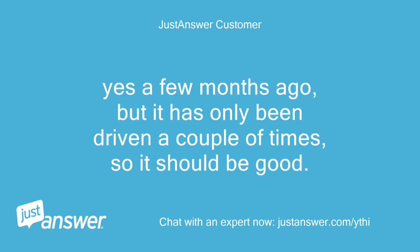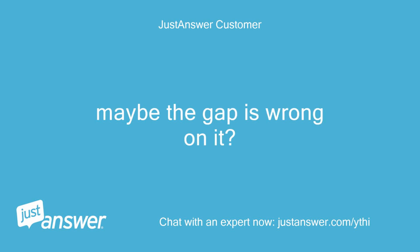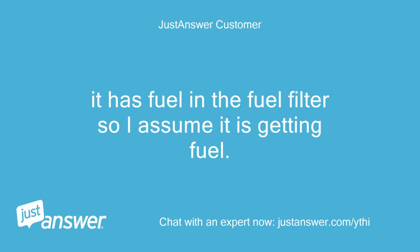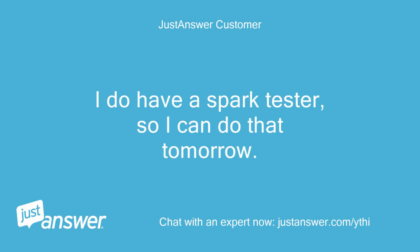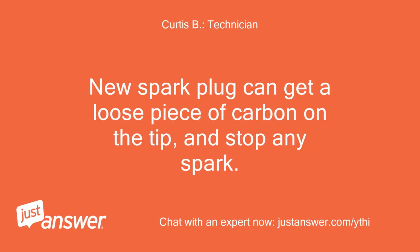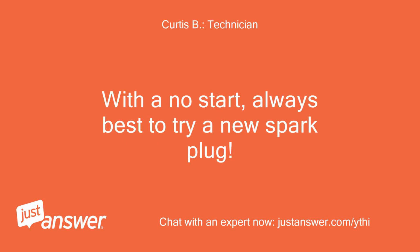Yes, a few months ago, but it has only been driven a couple of times, so it should be good. Maybe the gap is wrong on it. With everything brand new, I just can't see why it isn't starting. It has fuel in the fuel filter, so I assume it is getting fuel. I do have a spark tester, so I can do that tomorrow. Thanks. A new spark plug can get a loose piece of carbon on the tip and stop any spark. With a no start, always best to try a new spark plug.